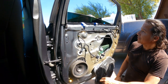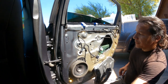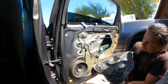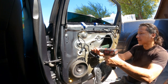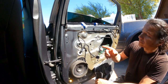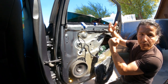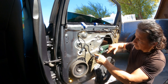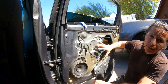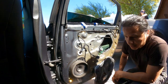Now we've got to start putting it together. One thing I recommend before you put everything back — make sure you connect it, everything is snug here. Snug. What we're going to do — we're going to turn the key on, roll the window up all the way to make sure when it's all the way up the regulator is going to sit in place. Sometimes it can be a little bit off for that little extra plate, the size of the holes. So it can be twisted a little, just enough to get the window going up. We want to try to minimize all the extra pressure.